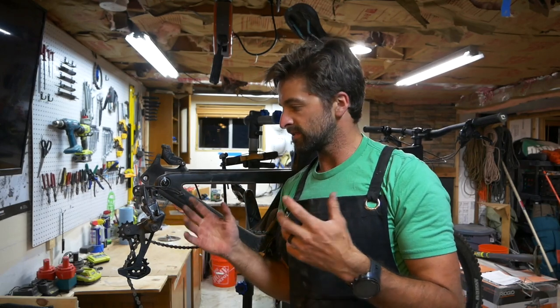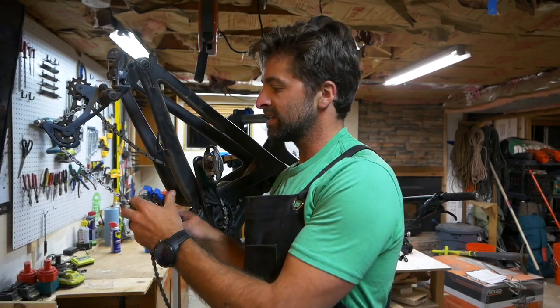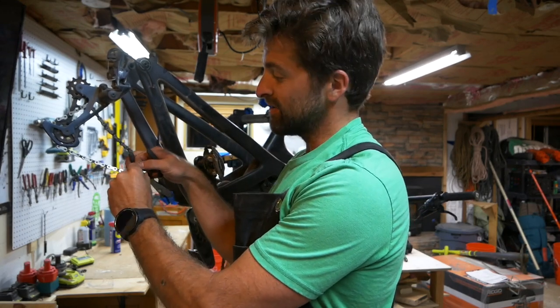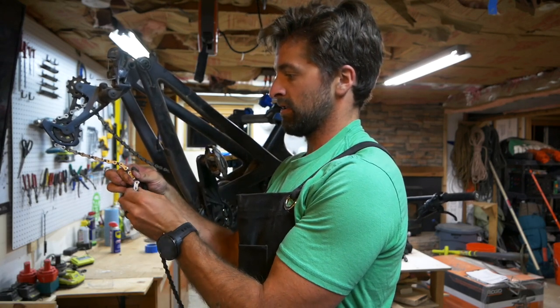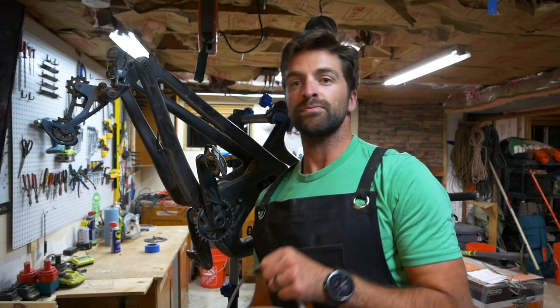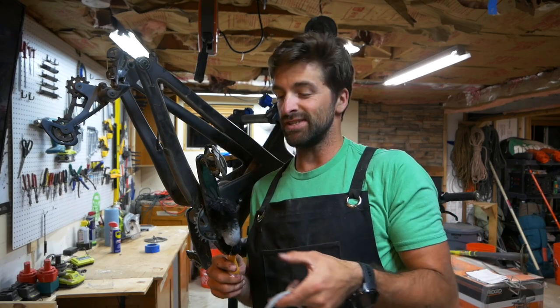Whenever I take the wheel off, it's always good to put the derailleur in the full extended position using the locking so it's easier to access everything. Once the wheel is off, next step is to get the chain off — you'll want to find the power link or quick link and remove it. If you don't know how to do that, I actually have a great video explaining it, especially if you don't have a fancy tool. Take it apart, be sure not to lose that quick link, and I'll often let the chain soak in degreaser or soapy water while I work on the rest of the bike. Then get your favorite bucket and scrub brushes — this is part of that $20 Amazon kit — and hit the jockey wheels and the front chainring.